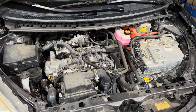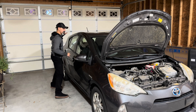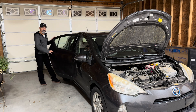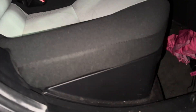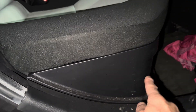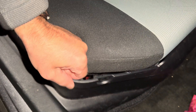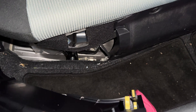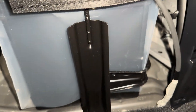So where you'll find the 12-volt battery — it's obviously not under the hood, and it's not in the trunk like some people would think. You're going to find it here in the back seat, behind the front passenger seat. Coming in here, here's our rear seat. You have this plastic skirt along the bottom. I'm going to have to remove that to access the 12-volt battery. We have two clips — I've already removed both. With that out of the way, we can grab this and pull it to get to the battery underneath. And as we come down here, this is our battery tucked under here.